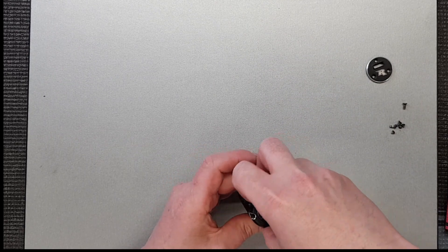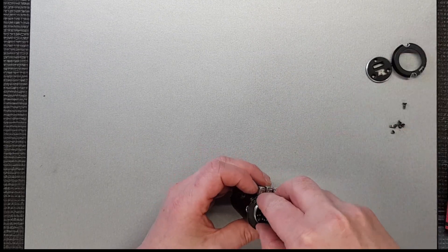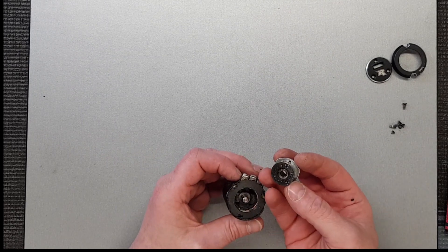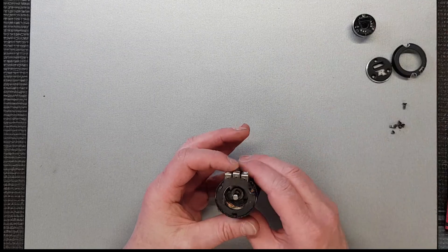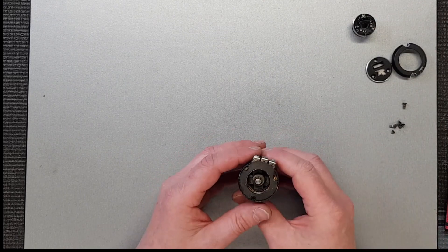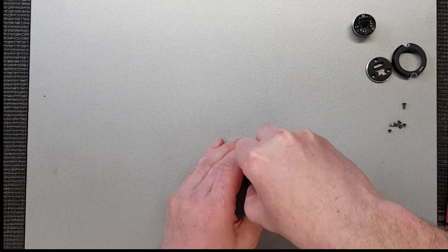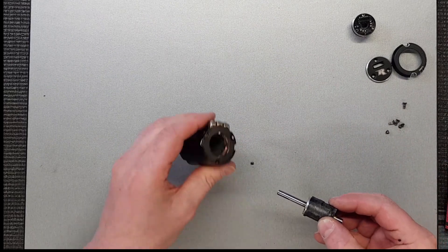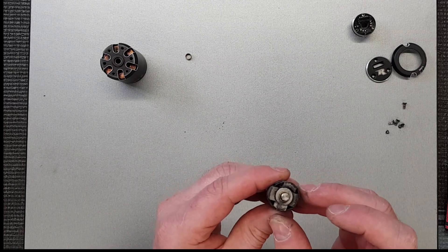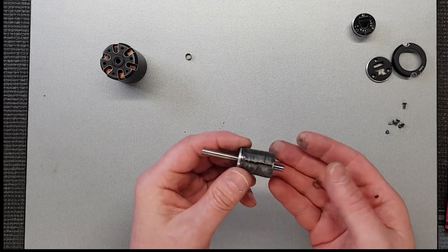That's the sensor board — for a sensored motor it knows the position of the rotor in the motor. I'm not quite sure how this motor comes apart fully. That metal bezel comes off and that's got a bearing in it. Yeah, there's a bearing in there — this could do with a bit of a clean. Looking in there, it looks to me like the rotor has exploded. Push that down, pull that out — make sure we don't lose that — and yes, you can see bits of the rotor. That has had it — it is shattered.